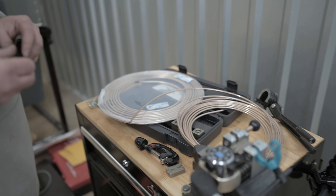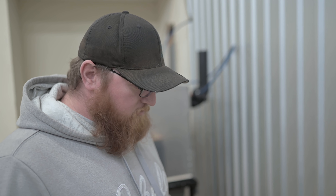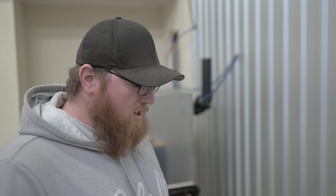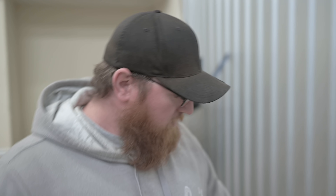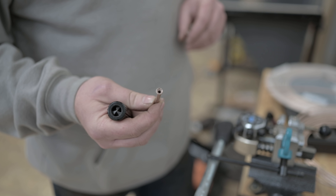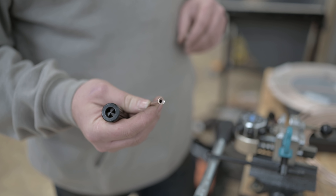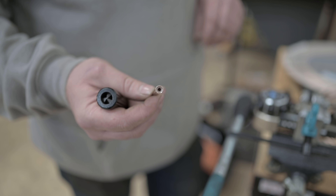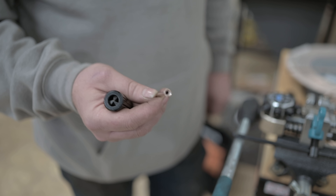You don't need a ton of equipment to make brake lines — you don't need the world's most expensive tools. It's mostly the process that matters. You have to follow the process to get a good brake line. If you skip the process, you end up with a crappy flare — one that just didn't invert, didn't tuck back in on itself. Here we got ahead of ourselves and didn't follow the process, so it screwed up the fitting.